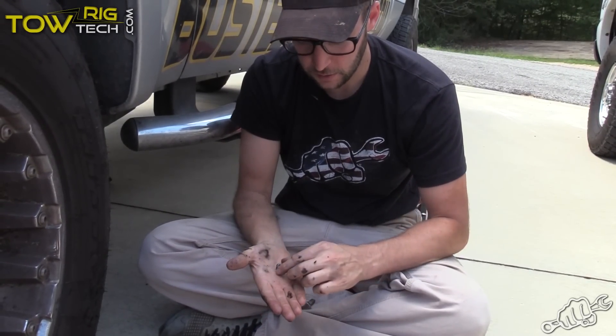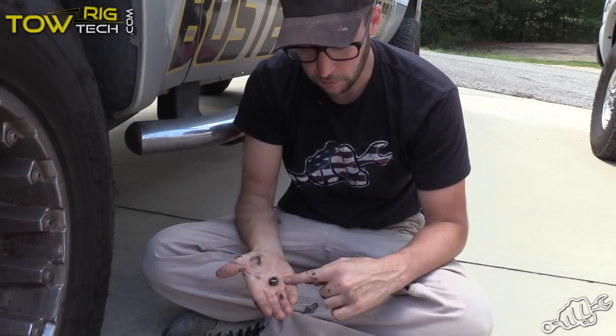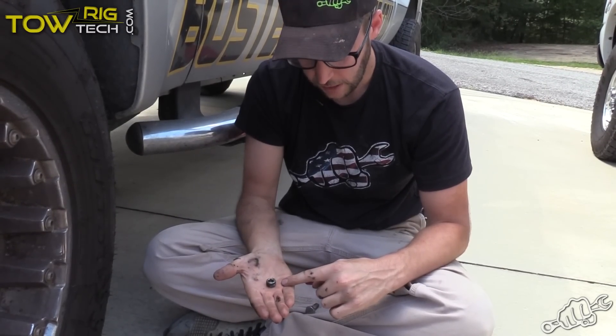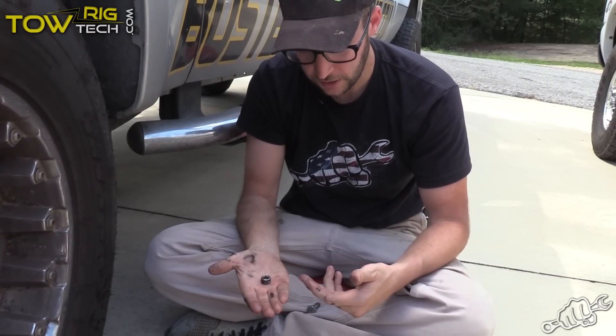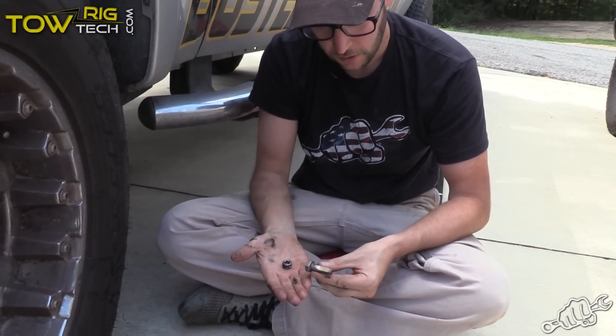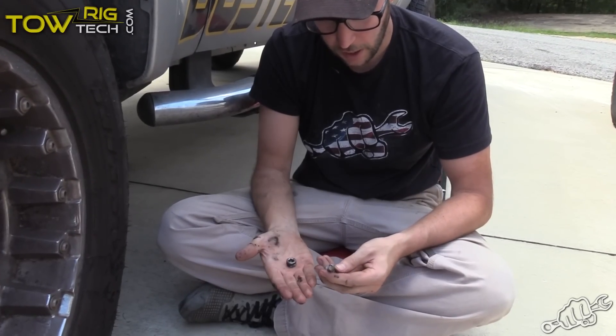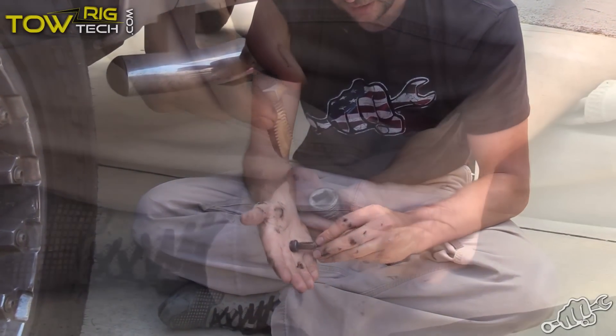This one, on the other hand, was a little more of an issue. This one is right above the oil pan, right by the oil filter housing as well. And it's not a quarter inch, it's not a 3/8ths — it's somewhere in between. So what we did was we took a bolt that was a little bit bigger than 3/8ths, ground it down, squared it with a grinder until it fit. And that's how we got that one out.